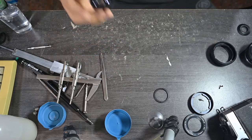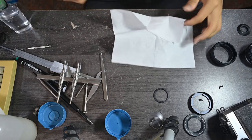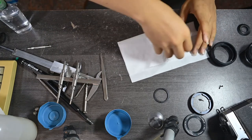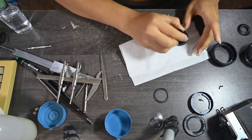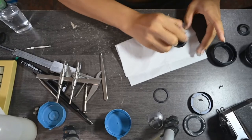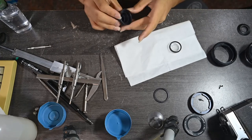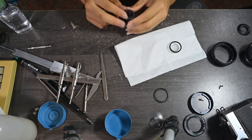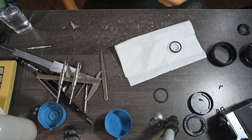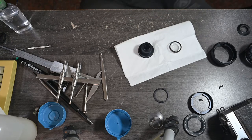Okay. Take yet another tissue, this is for cleaning the lenses. Come on. Nice. This is clamped in, so you cannot clean this from the outside, you have to clean it from the inside. This guy will take some alcohol, I think. So actually, no, let's use some lighter fluid, because alcohol is a bit more destructive than lighter fluid.